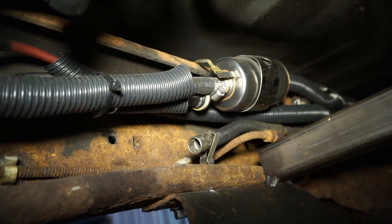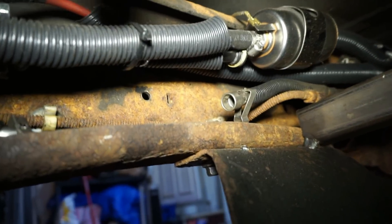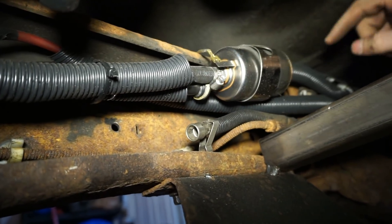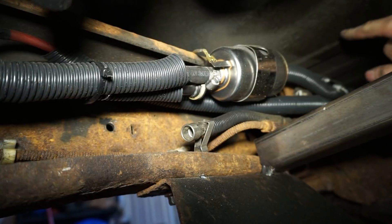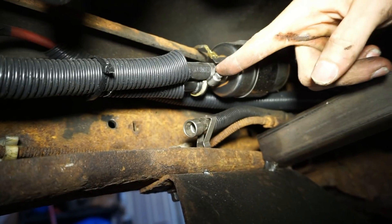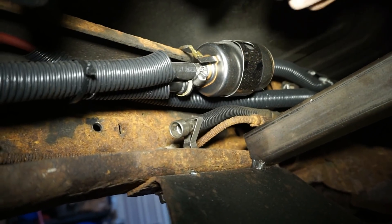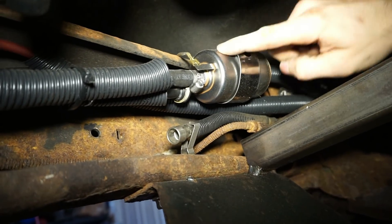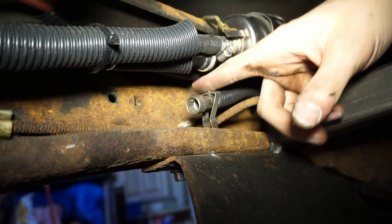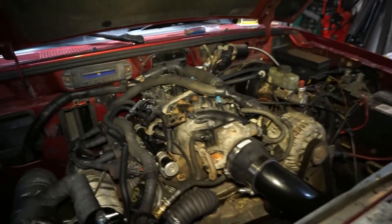For anyone not familiar with how I have this now — this is my filter regulator, I think it's one of those Corvette units. It has a 3/8 feed, a 5/16th return, and a 3/8 feed all the way up to the fuel rail. What I'm going to do is bring that return line back here, splice it into my return, and splice the two 3/8 feed lines together. I might try to incorporate some of the factory 5/16th line into there — that'd be kind of sweet.